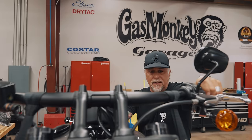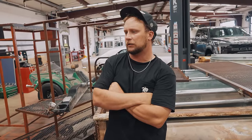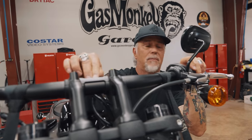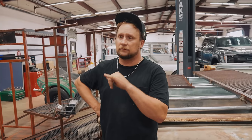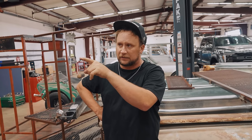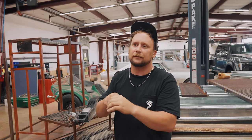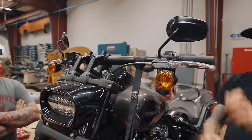I knew it. I want to find some moto bars for it. Ooh, I can't remember who I looked at. It might have been Renthal. I found some the other day. Well, but you're wanting a crossbar, is your biggest look, right? But I want it to be a fat bar. They come with the crossbar. Are the controls going to be the same? Because I did that on a Sportster one time, and I had to change every control because the bar ends were so much smaller. So the ones I found are made for your factory controls. You just have to de-pin them because they're pinned. Yeah. Okay. So you'll have to de-pin them or drill a pinhole into that handlebar. I mean, those risers don't look horrible, but yeah. No, they have a moto look. The risers don't bother me.